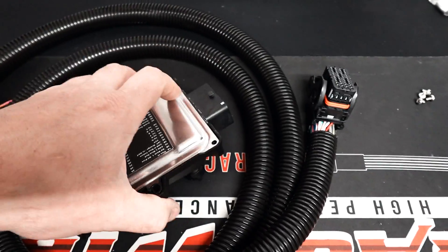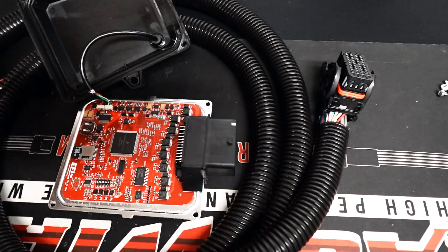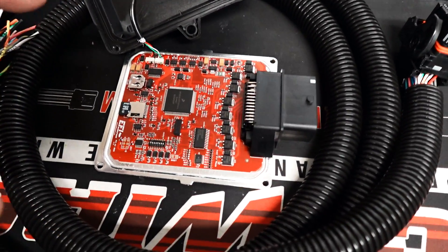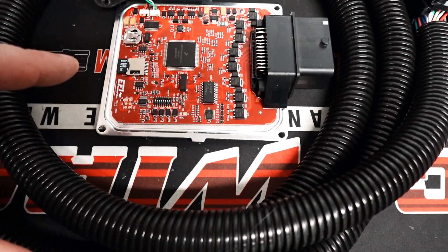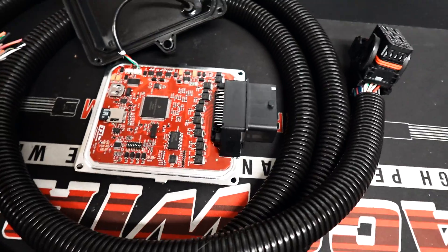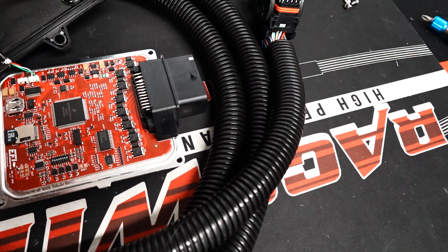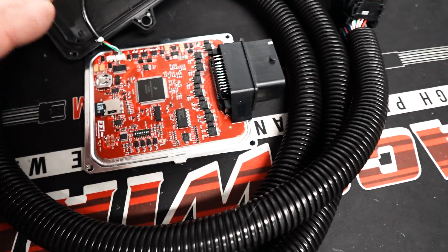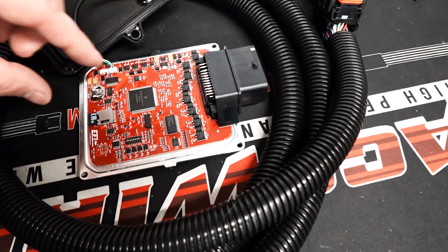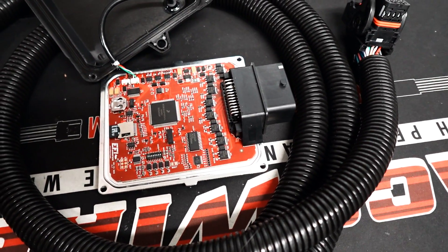Mike took an entire Gold Box — the Gold Box is a V10, it has ten ignition and injector drivers. What he did was condense it down and put eight, since the V10 guys for Dodge were frothing for it and then never used it. It's one of those scenarios — like guys with S10s who prepay for turbo kits and are all onboard until it comes time to pay.